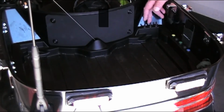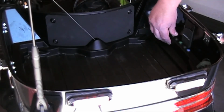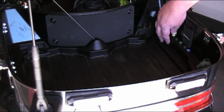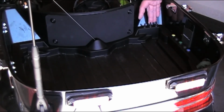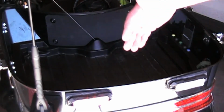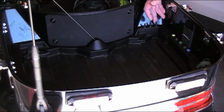Okay, so now I have the yellow and the blue. Yellow with a black. Yellow only is going to be when they're in sync mode, and I push the button and that will change the pattern. If I need to go back and resync these at any time, you break the yellow, which is this switch. I push the green, which is equivalent to the white in the programming, for 2 seconds, and then it goes back into my alternating mode. Normally run those in the fourth position.